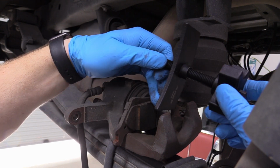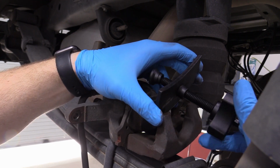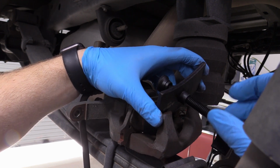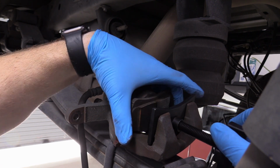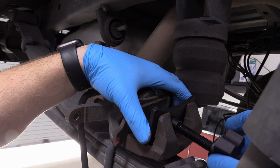That specific job is for brake caliper retraction, piston retraction into it. I understand if you don't have one of these, they're a pretty weird tool, but the link is down below in the description. They're not terribly expensive. Alternatively, you could just use a C-clamp, but make sure you use the brake pad as a buffer medium because you don't want to crack the piston inside of the caliper, which you can totally do.